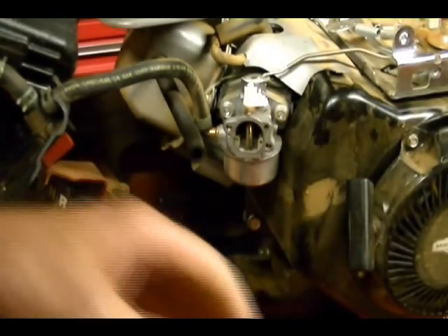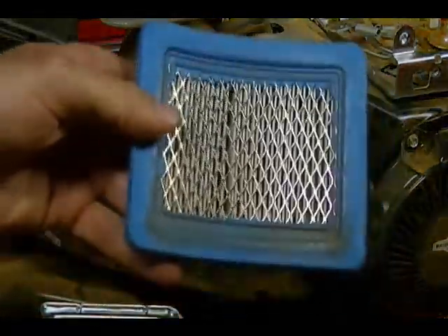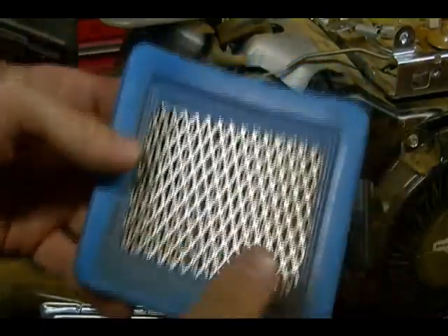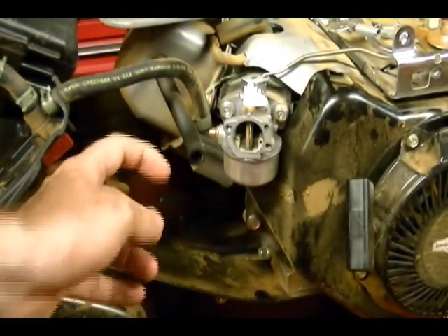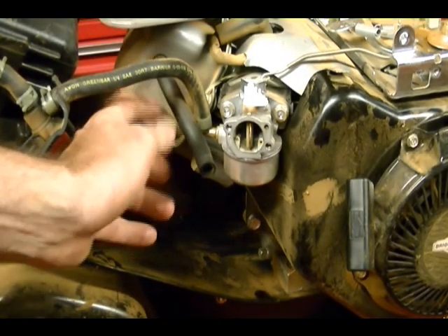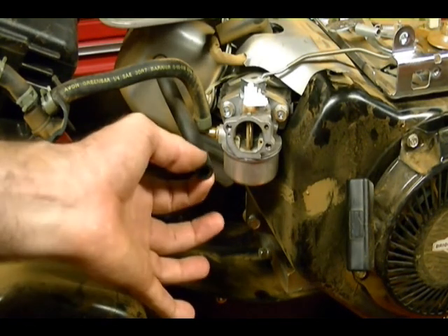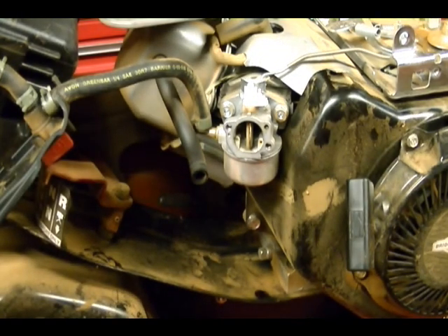What I'm going to do to correct this problem is get some high temp grease and a new air filter. I'm going to wipe the high temp grease around the air filter to get a better airtight seam between the air filter and the air filter housing. I'm also going to use the high temp grease on this vent hose where it attaches to the air filter housing and where it attaches to the valve cover, and hopefully that will solve the problem. Make sure you use high temp grease because if you use a cheap grease, when it reaches a certain temperature it will run.